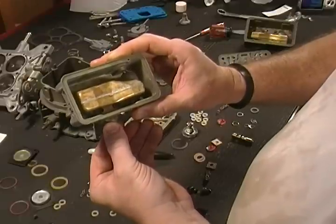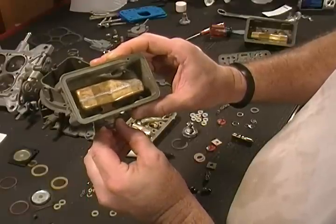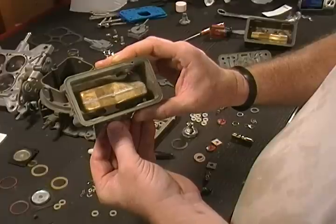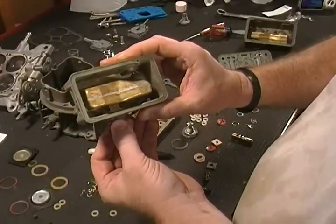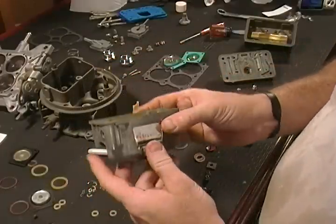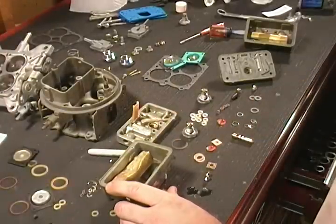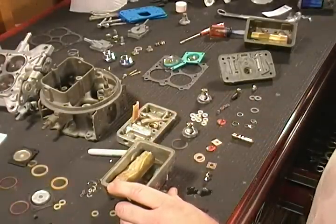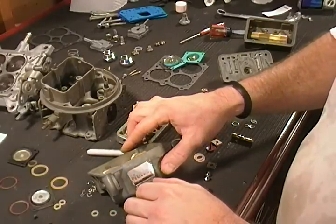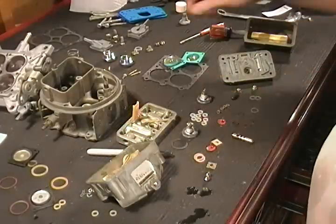This is my front bowl, so I'm actually going to go a little deeper — I want to make sure I can see that whole screw head. The reason is we drag race this car sometimes and I don't want fuel spilling out the vent pipe, so I'm keeping the fuel level a little low in this bowl. We have a good fuel pump and a pressure regulator so we don't get too much pressure overriding the needle and seat.